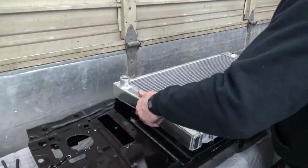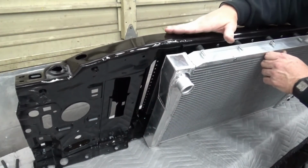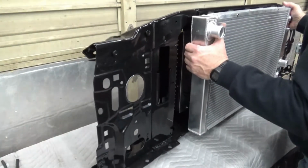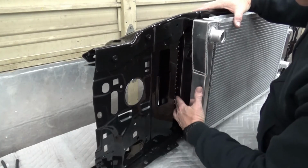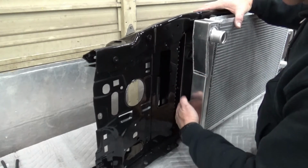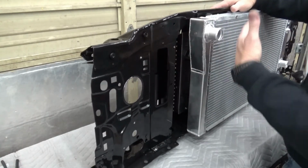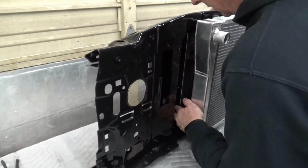Alright, so now that our radiator is mounted, again, when I make a nice pretty cap for this, I'll put a piece of foam in here to seal off that air gap. And also, now that I've got that mounted, I can measure in between this original mounting surface for the condenser and the radiator and make a filler panel in there with a foam seal against the radiator that will in effect turn this entire center area into a shroud and force all of the air to come through the condenser and then through the radiator with almost no leakage otherwise. So pretty efficient.